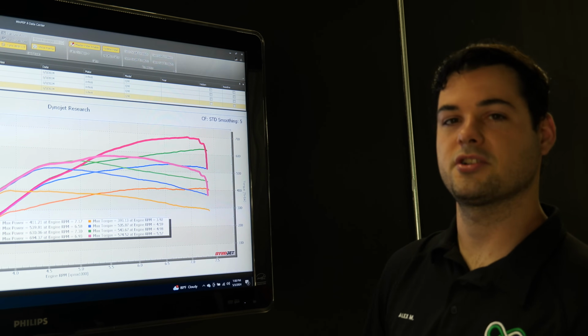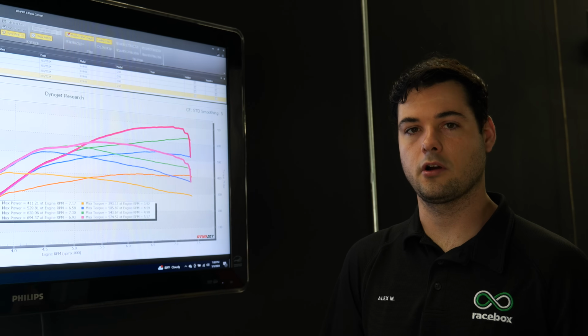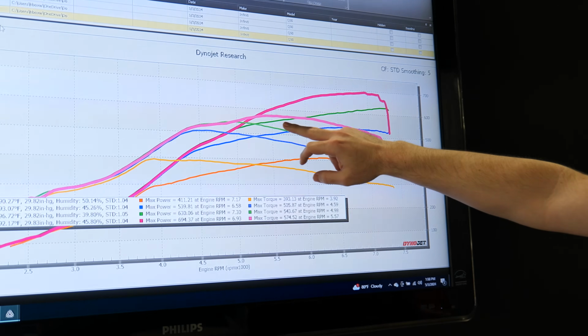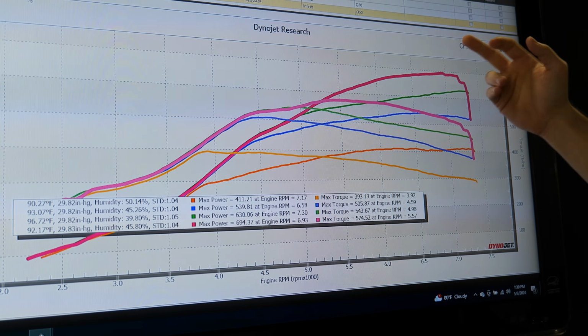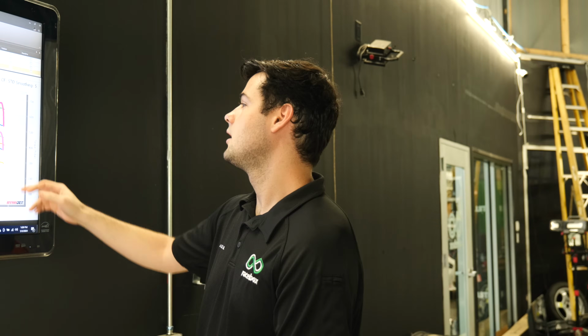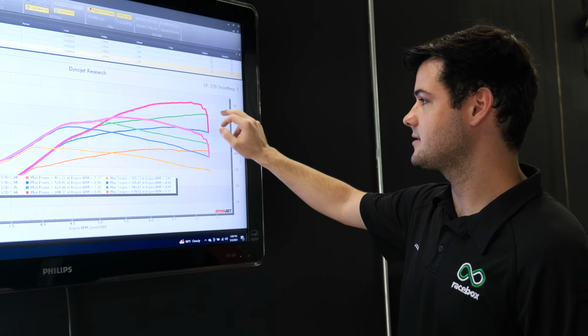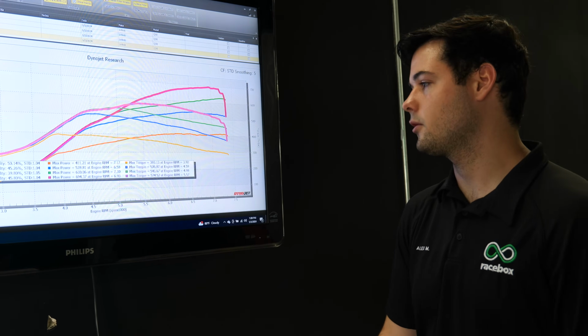Then now we actually push the vehicle to the limits as far as we're able to do regarding fueling and torque. So we bring torque up to about 574 wheel torque, and then we're limited on the top end with boost because of the fueling limitations with the stage one injectors, the low pressure fuel pump, and just the restrictive exhaust. So we reduced boost a little bit. This car is peaking at about 25 and a half, 26 PSI. We're still able to get 694 wheel horsepower and 574 wheel torque.